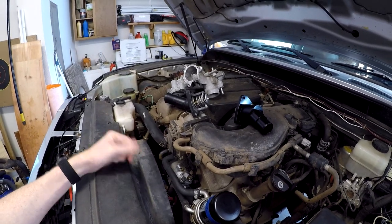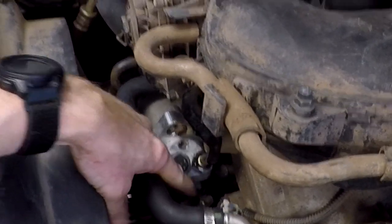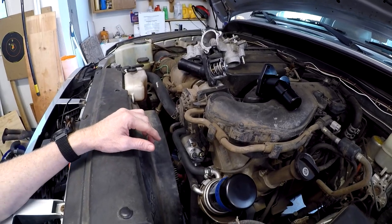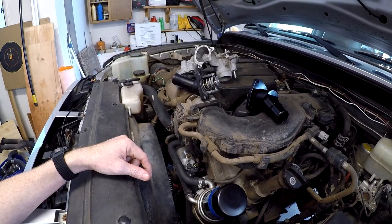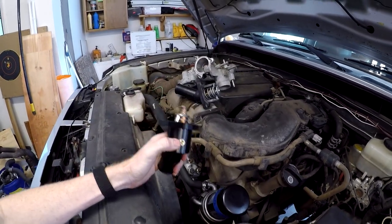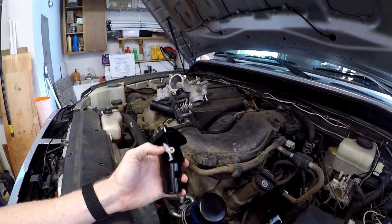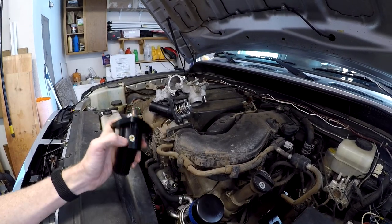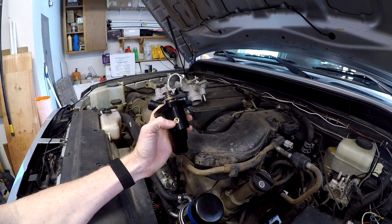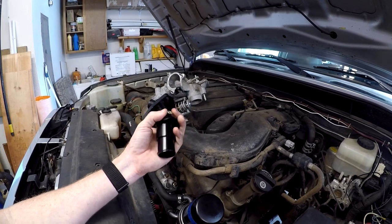There's no signs of any coolant leaking around it — it's just dirty. You can see the edge of my bike tube sticking out right there from where it's crammed in between the radiator hose and where it goes on that inlet. One other note: if you want to put a sensor here, you can't really put a temperature sensor on this side of the thermostat and expect to get usable coolant information — this will only show you coolant temperature on the radiator side. You can put a coolant pressure sensor here, though the pressure sensors are usually a little fatter and may stick up toward that bracket.